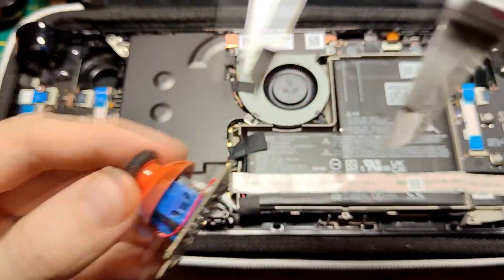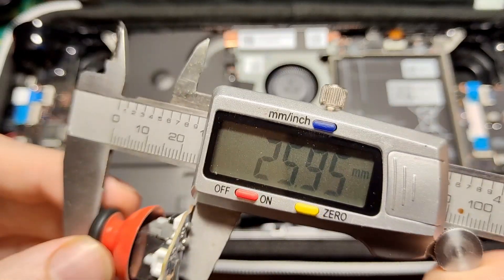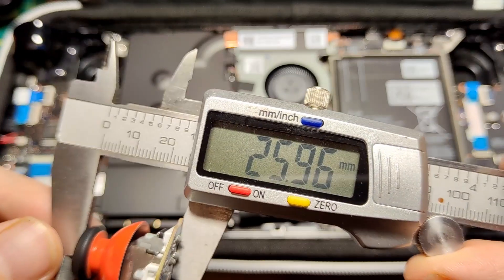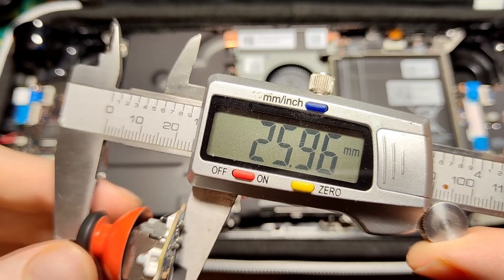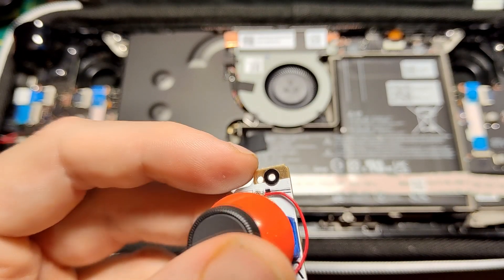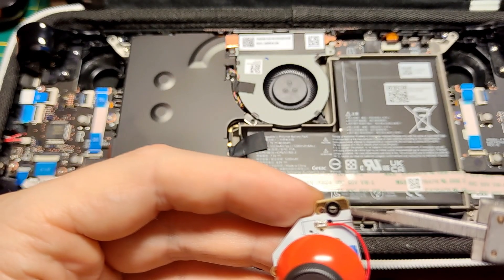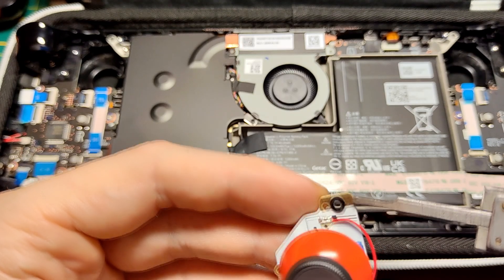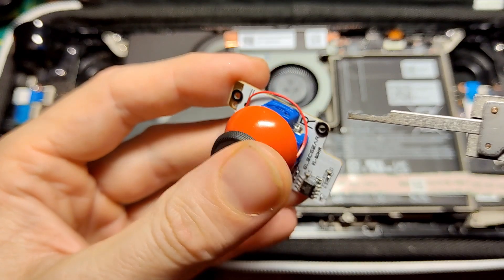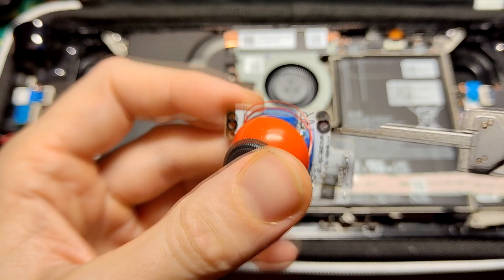When doing some measurements, it quickly comes to light that both the GullyKit and the AlecGear are taller than the original thumbstick. Having used GullyKit almost exclusively before, I already had to solve this problem by either filing down the post of the thumbstick cap — which is not very nice — or the non-destructive version: 3D printing little shims with a height of 0.3–0.4mm to put on top of the screw holes, getting the needed distance so the thumbsticks can move freely. I also showed this in another video, linked below.